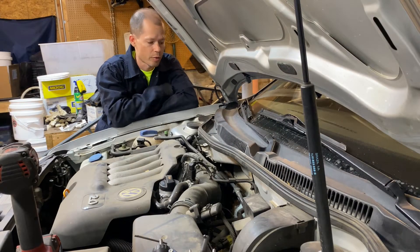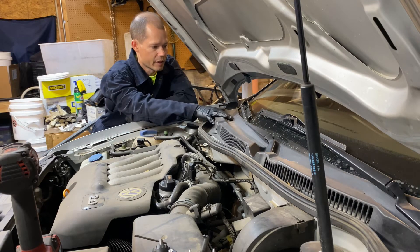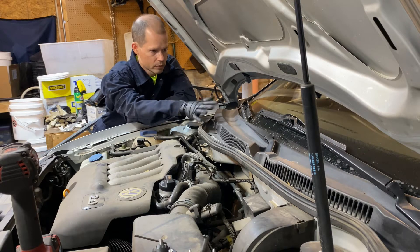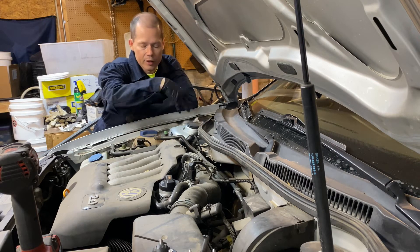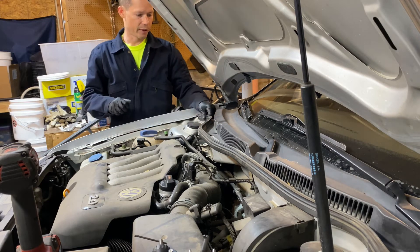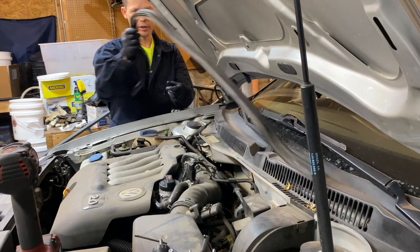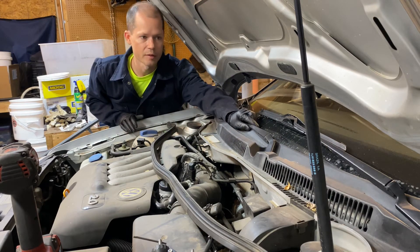To complete this repair, other than putting your fender liners back on, we're gonna want to remove this rain cowl — the upper rain tray — so we can get into the main rain tray down here and clean out any debris and dirt that's still in there. Start by pulling this rubber piece off, then the next step is taking off the windshield wiper blades.